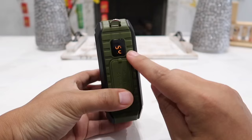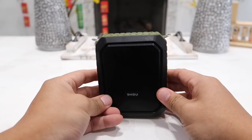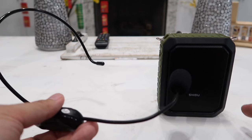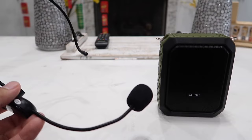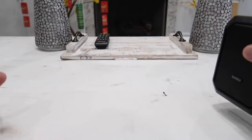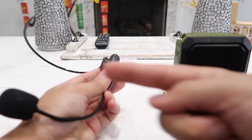On the side it displays how much battery life remains — right now it's at 54%. Once we have this turned on, go ahead and turn on the wireless microphone. A very important thing to pay attention to: do not point this microphone towards the speaker because it will cause a very loud screeching sound that will hurt your ears. Point this microphone in the opposite direction from the speaker, and it's best if these two pieces are at least two feet away from each other to avoid any screeching.